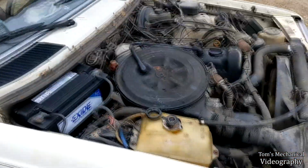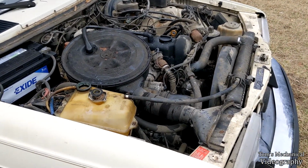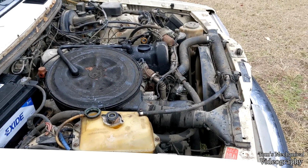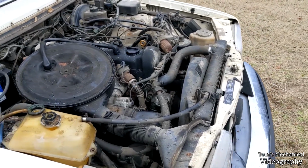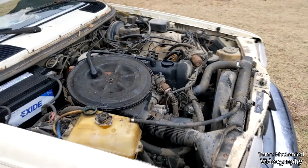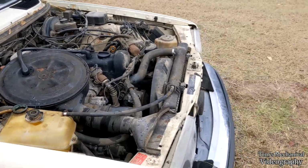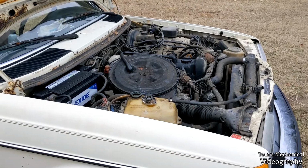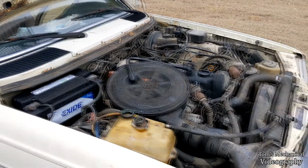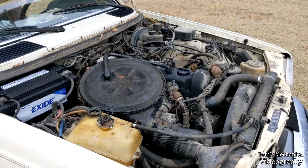So it is 10:18. I'm just gonna let her idle till she gets up to 100 degrees. And actually no, I'm gonna feed her the beans there until she gets up to 100 degrees, because I want that water pump moving with a lot of force so it can push whatever the hell is in the way out. And yeah, when she hits 100, I'm just gonna cut her off and let her heat soak, and then go about my day. And when I come back tonight to offload all the tools I just loaded up while I was cycling the glow plugs, I'm gonna do this again, and I'm gonna try and do this a couple more times, then do it again once the weekend comes, and then we'll drain the system and add another thing of flush.